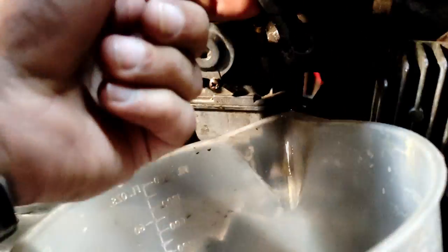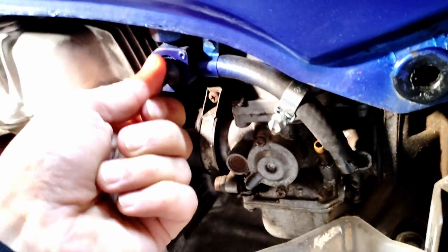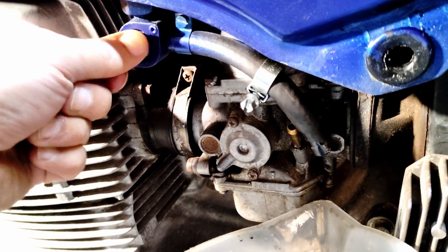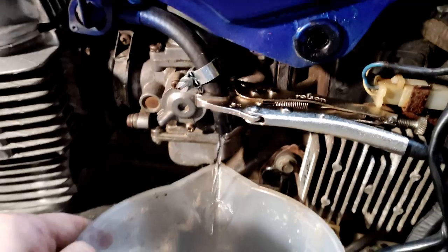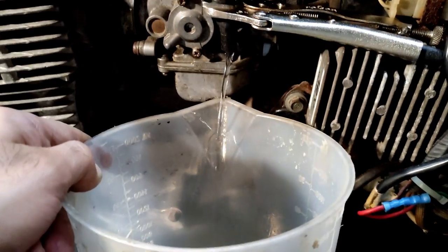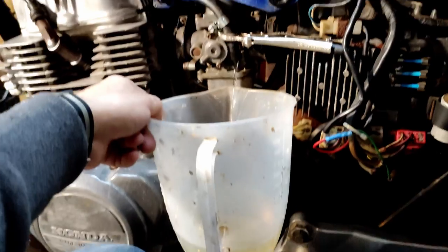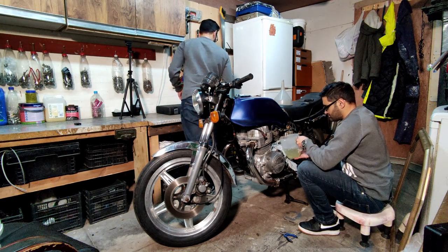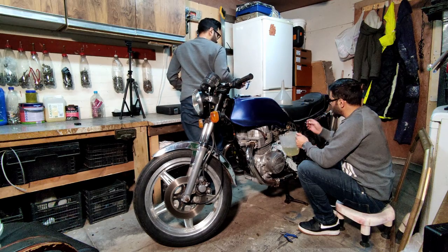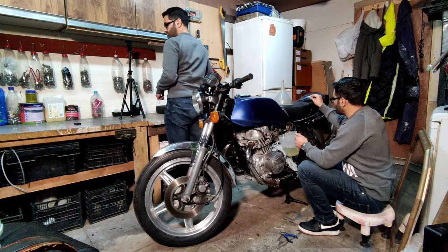First, what we're doing here is taking off the fuel line from the motorcycle tank. It normally comes down the side of the tank — if you have side fairings, take those off and you'll see this underneath. It has a jubilee clip which you can basically just unscrew. I'm using a mole grip here to help keep it away from the tank so it can just drain out easily. Some have jubilee clips with screws, others have a spring-type fitting.